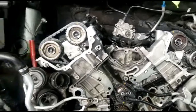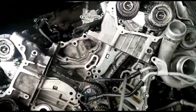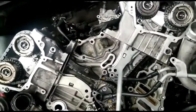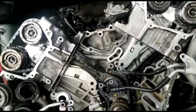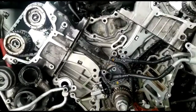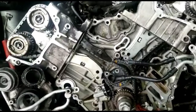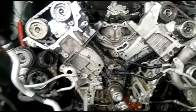This car went to Mercedes-Benz and they actually changed the head gasket, but what happened is they torqued the engine too much and they ruined the threads of the bolts on the head. I had to put helicoils in to put in new bolts, and I tied it up and it came out good. I put the new head gaskets in.